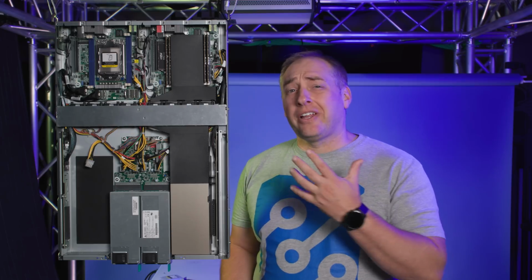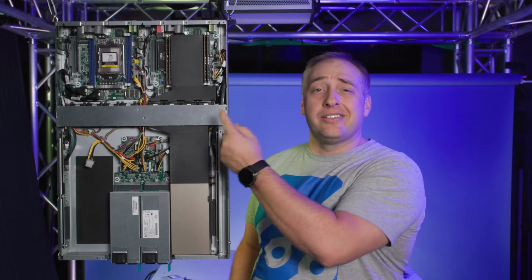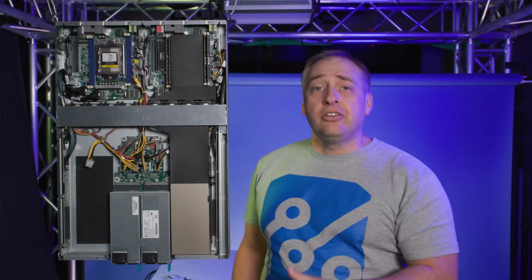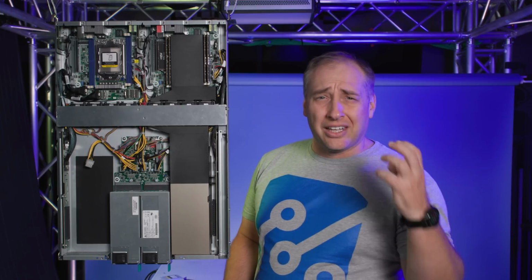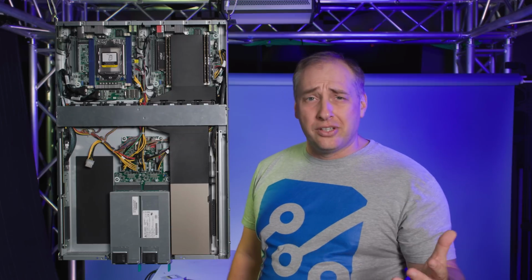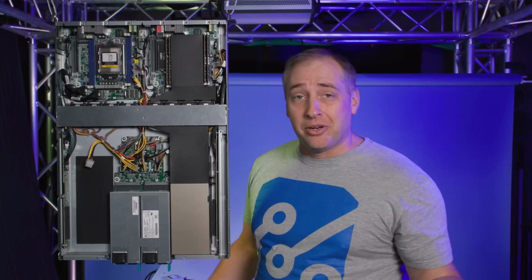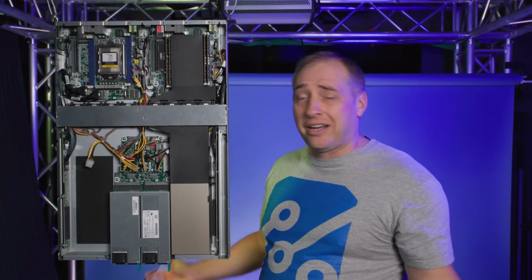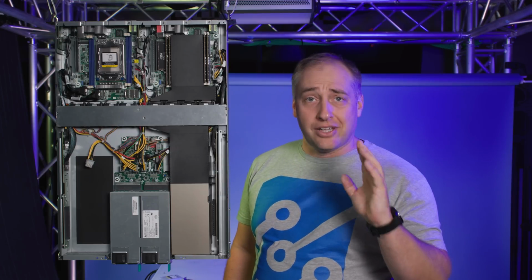And if you're using this for a hosting market, we have 64 gigabyte DIMMs in here, so that means that we have 256 gigs in this node right here. But you could of course go lower, and you could put 16 gig DIMMs or something like that if you want to just have a 64 gigabyte node that you're selling in a dedicated server, dedicated hosting market. You can also go up to higher memory if you really need the capacity for some kind of client or something like that. You are limited, though, in that you only get 4 slots. So that is what it is.